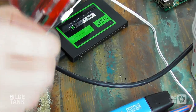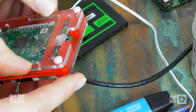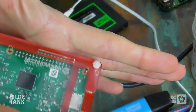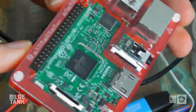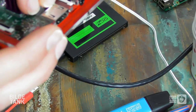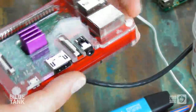As you can see on the bottom, we've got these two tiny edge vents, and slots down the edges as well. That's just to improve airflow through the case. You can attach a 30mm fan to each side, maybe some liquid cooling. And on the top side, obviously we've got the hole for the processor. Again, it's just to provide a bit of extra venting, but also so you can mount a heatsink. In day-to-day use, you really don't need it. And the CPU will auto-throttle, so it's never going to get dangerously hot.